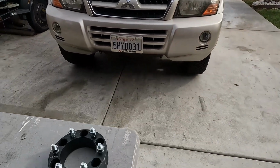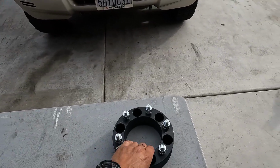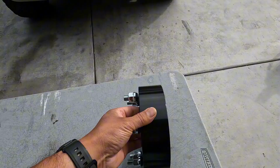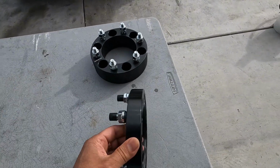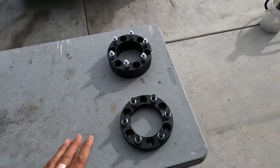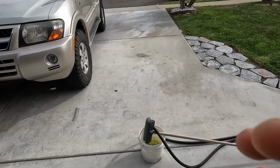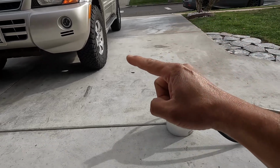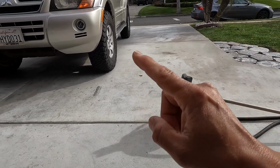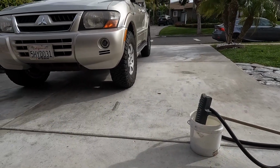So here are the spacers that I used. It's these guys, and I'll link them in the description of this video if you want to purchase these on Amazon. These are the 2-inch, and this is a 1-inch. With this setup, I have the 2-inch in the back and the 1-inch in the front. And with the 1-inch in the front, you don't have to worry about cutting or modifying anything.